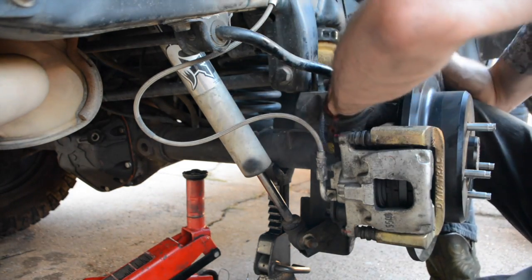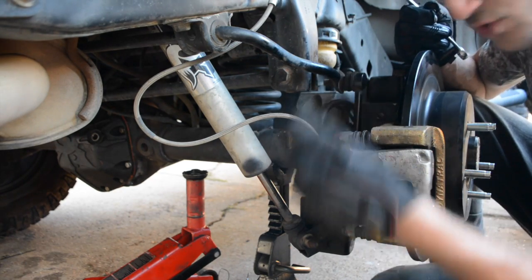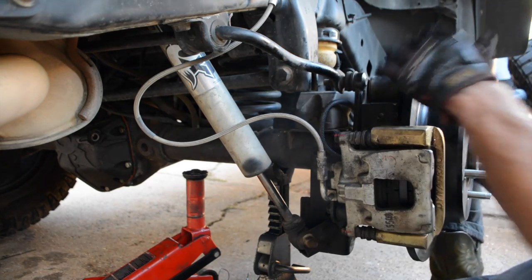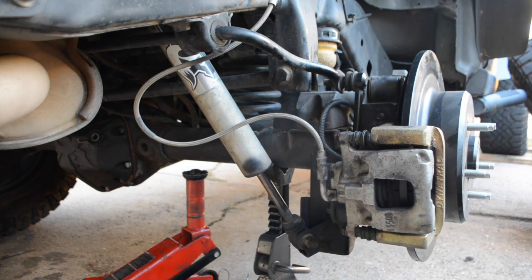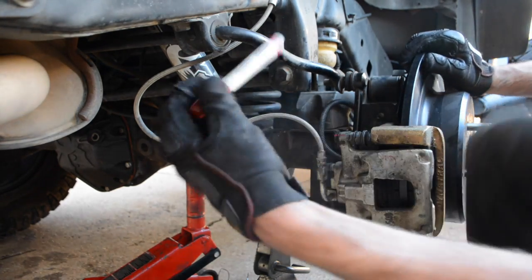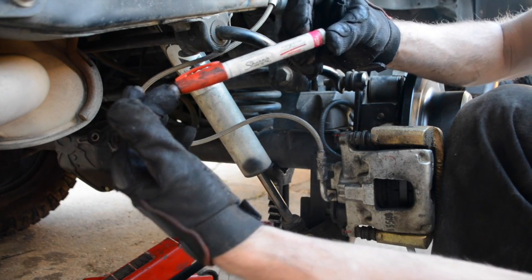We're going to go ahead and get this guy tight. So once we get him tight to 65 foot-pounds, so it's 2 bolts, 65 foot-pounds. What's smart to do, and is a good thing to keep in mind and practice, is go ahead to Walmart and get one of these Sharpies. They're paint Sharpies, so they're oil-based.